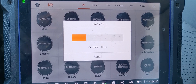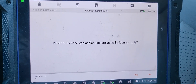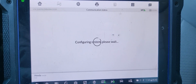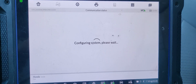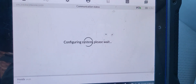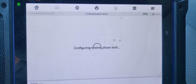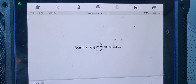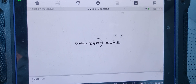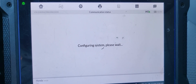I'm going to go through the immobilizer now. I don't believe this is going to work. Establish communication, configure the system. Hopefully it's going to go. If it's not, that means what you need to do is take all this wire, change the harness and modules. Any module that gets water into it has to be replaced and then configured all over.